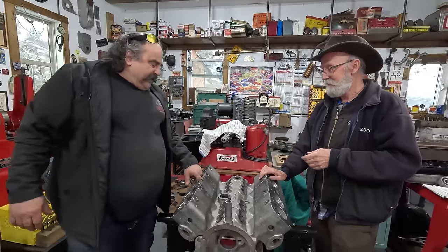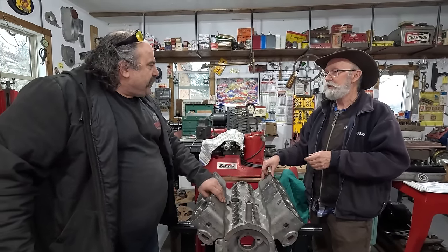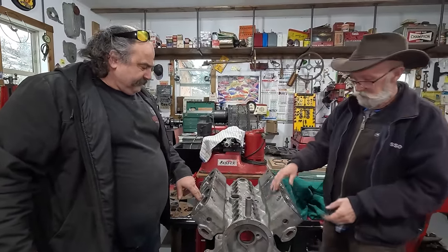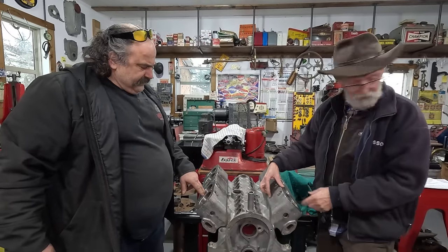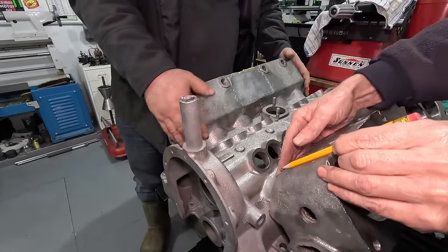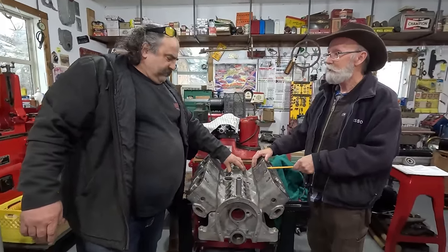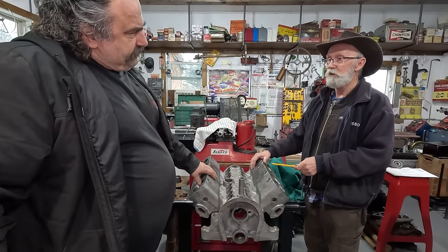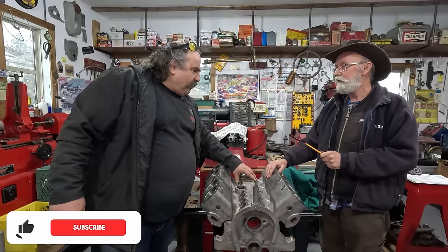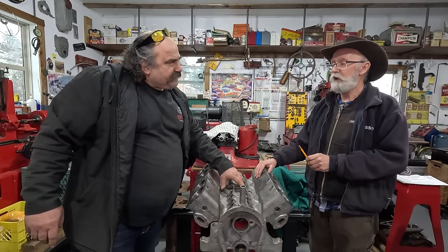As I remember about the flathead, the biggest problem they had was the casting of the blocks for the water jackets and the cylinders. It was one of the biggest problems they had — that's why those blocks were cast the way they are. They don't go all the way down. This block here doesn't go all the way down either, but it comes down a fair ways. This was a major, major thing — casting this block back in the day. This is a monoblock, and every V8 in that era was bolted together: two four-cylinder banks bolted onto a common crankcase.